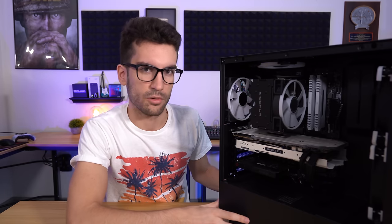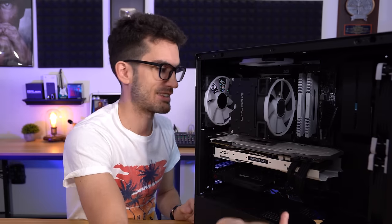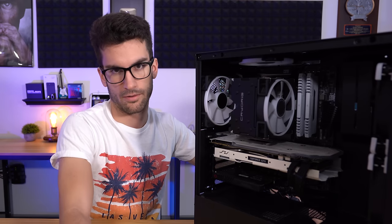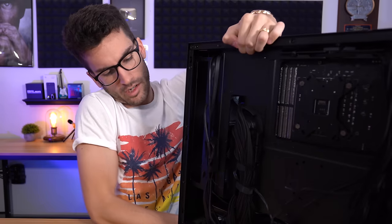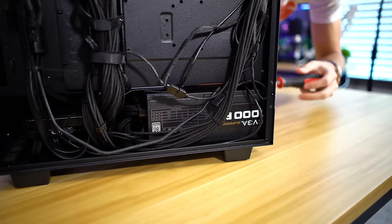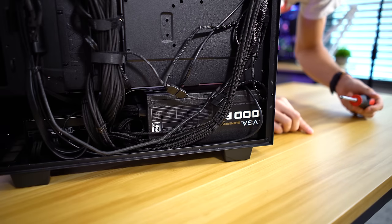All I'm going to do is unplug a single cable. It would be super obvious to unplug something on this side — they'd probably think it was a joke. I want to give you guys an informed decision about whether you should fix this yourself, send it to somebody else, or maybe you just don't have the time to troubleshoot your own PC. Should you bring it into somebody? That's what this video will seek to answer: is Geek Squad a viable option? So we're not going to unplug anything on this side because that's too obvious. I'm going to unplug a single cable that connects on the power supply side to the PCI supplemental power on the graphics card.